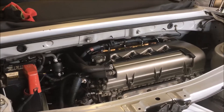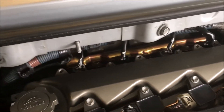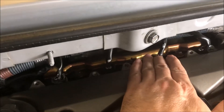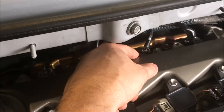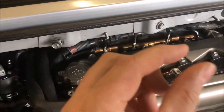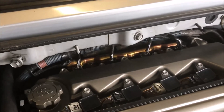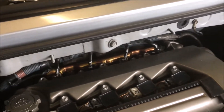I had a little issue with my injectors — I thought I was recording it but ended up not. I installed them all and started up and it was running really rough. I thought maybe the computer was trying to figure it out, but I came back and looked and number two was not seated down inside — gas was just shooting out all over the place. Luckily I caught it and turned it off before it caught fire. I got it dried out and cleaned up, took them all out again. Since you can't see them and can only feel them with your fingers, I just missed it. I pulled them all out, checked them, lubed them up again, and re-inserted them. Now I'm running just fine, so hopefully I don't run into any more errors.